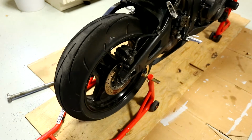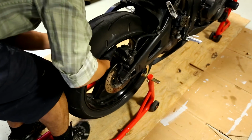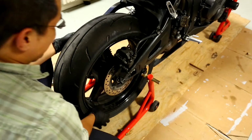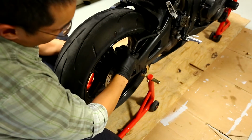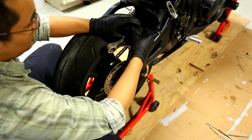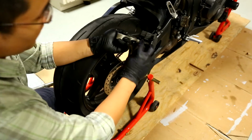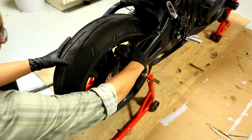Okay. So we're gonna lift her up. Oh man. Okay, so we lift it up. Oh, see, one spacer already fell out. Make sure that your calipers are nice and spread apart. Okay, that brought that right piston down. So now, see, we got a lot more space here that we can work with. So now, this should go in a little easier.